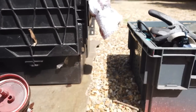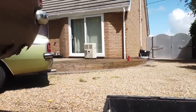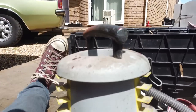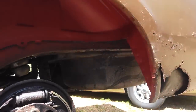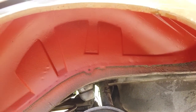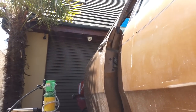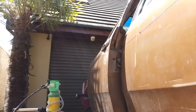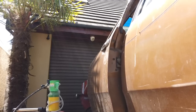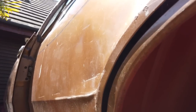So I've put the red oxide on. There's the red oxide. I diluted it down with thinners. It would be too thick normally for this to push it through, so some thinners on it, but dries nice, dries quick, dries nice, and it's hard to scratch off. I've been up to the front where I've put it on at the front, and it's very, very tough. It doesn't sort of scratch off with your nail. You've got to really bite into it, so it's certainly gripped the metal. I think it's going to be a great undercoat for us.